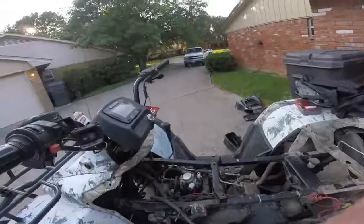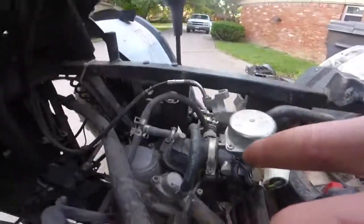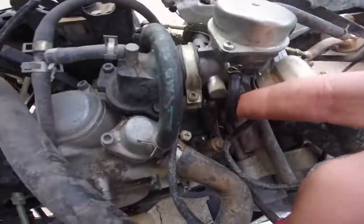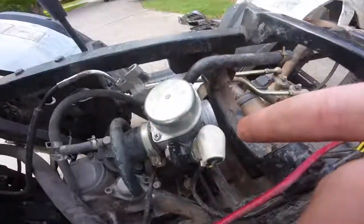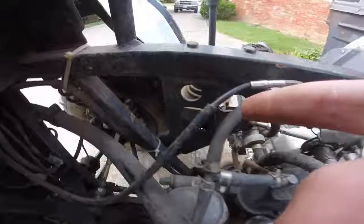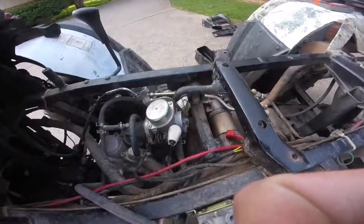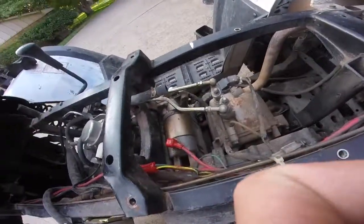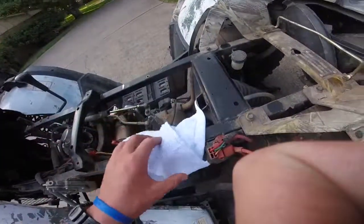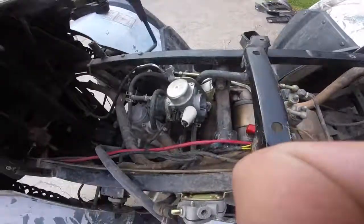So now what I did before I take the carburetor out — all I need to do here is loosen that screw there, or loosen it from the head, and then just a couple of gas lines and cables — automatic choke, throttle cable, and yeah just a few more cables but that's about it. I cleaned up the alternator right there with this rag here and just some other places around the engine bay to keep it all tidy.